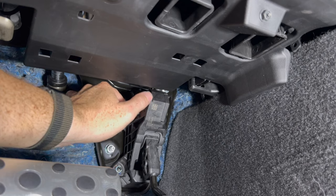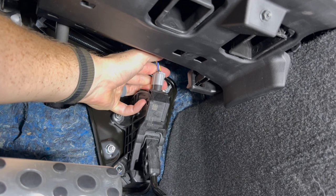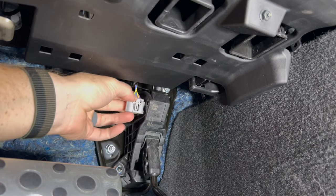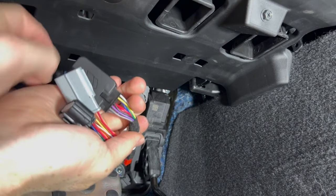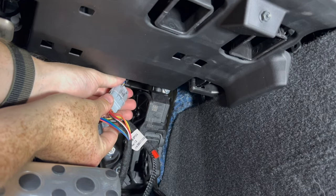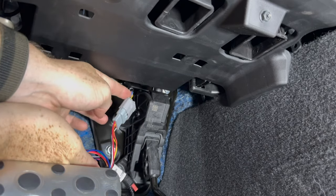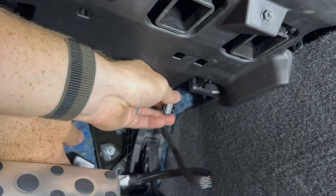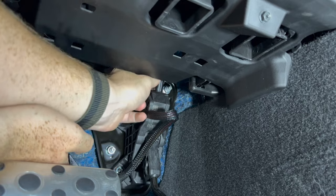So on the Tundra down here, it actually looks like it's a little bit difficult to see, but if you just lift this part of the plastic up, you can see this part right here. This is the stock input right up here. So just go ahead and kind of push this plastic back. This harness comes off with a little depress right here of this tab. So we're going to go ahead and unplug this from the gas pedal. We're going to take note of what this side looks like because we're going to plug in the opposite side. So this male to female right here, go ahead and plug it in, make sure it snaps into place. And then since we took this part off of our gas pedal, the kit comes with its replacement. Go ahead and put that up there and snap it into place.